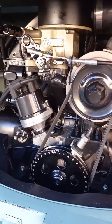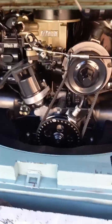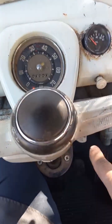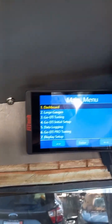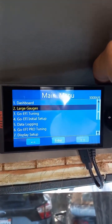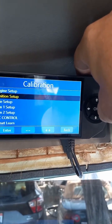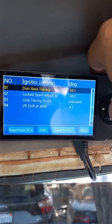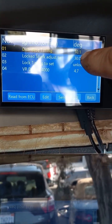Once you've got the crank trigger verified and your distributor phased, the next thing you're going to do is go on the handheld. You'll want to go inside, turn your key on. In this case Joey has his handheld up here. Using the little joystick buttons, scroll down to EFI Initial Setup, press OK, then go down to Ignition Setup, press OK. Under this section you'll see you've got your 10 degrees, which is your crank trigger or distributor based timing depending on what you're using.